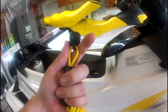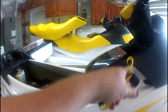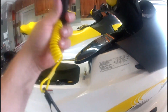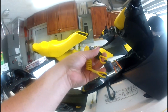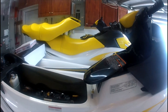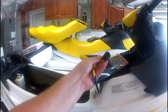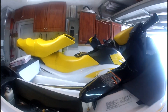Before dropping a grand on a new computer, I found a guy on Facebook Marketplace who sold me a replacement DESS post and made two new keys to replace the suspected bad one. And wouldn't you know it — it was the actual key that was bad. The chip inside was shorting the entire system. I almost spent a thousand dollars on a new ECU that wouldn't have fixed anything. So guys, don't overlook the obvious — try the key first if you've got these issues.